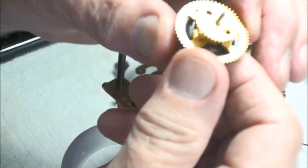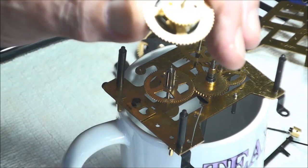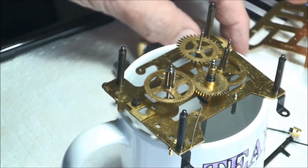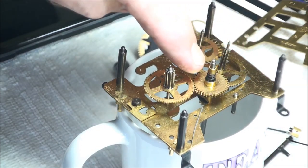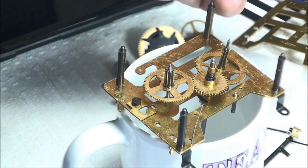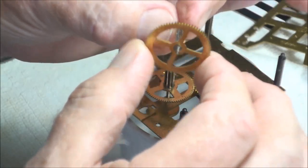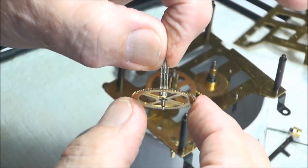The clicker in here — this happens to have a good clicker. What I call a good clicker is one with a spring that comes around and hits a little lever right there, compared to a disc with plates on it that I don't like as well. That one will stay because it's pressure fitted — we'll talk about that in a second. This is really oily. No big deal, we'll get that all cleaned up. It's a little dirty-looking inside; you can see some buildup of dust and whatnot in the gears.